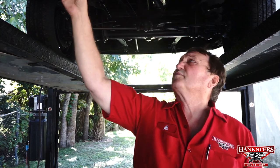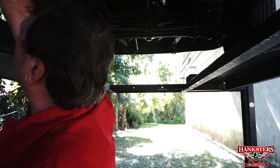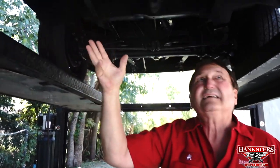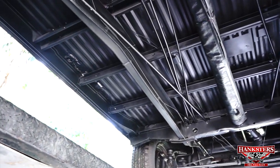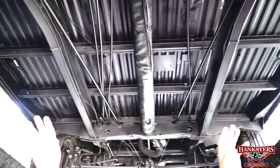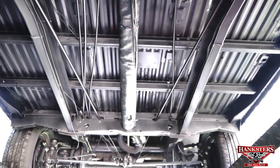You can see all the structural components across the floor pan itself. There's a little tiny bit of a perforation there — a little bit of corrosion. Maybe a piece about that long. Doesn't appear that it's gone through anywhere. The same over there — there's like a little tiny smudgy spot on it. That's it on those two spots. I don't understand why, because the rest of the pans are absolutely flawless. Those two have a couple little flaky pieces, but the rest of them are solid as a rock. There's no deterioration whatsoever on the drop downs for the rocker panels.